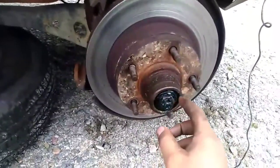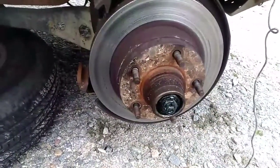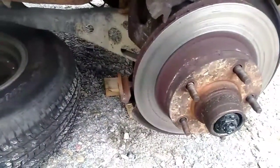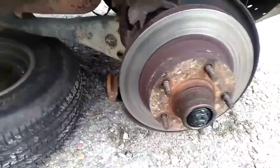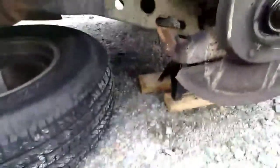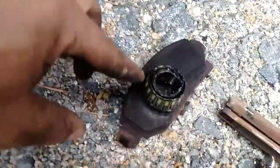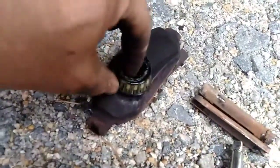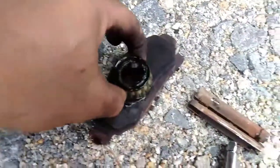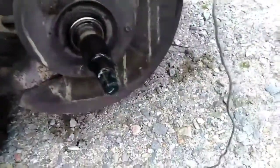So I'll go ahead. All that's left is just take off this one bolt and everything comes off. That's it. Then I'll clean it up to have it go on a lot smoother, put some grease on all the metal to metal pieces. That's about it. Once you take off the nut, you can just pull it out. There's a big washer. And that's the bearing. Bearing is actually in very, very good condition. Shaft is in really good condition.